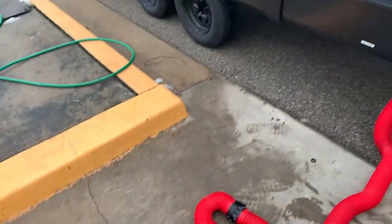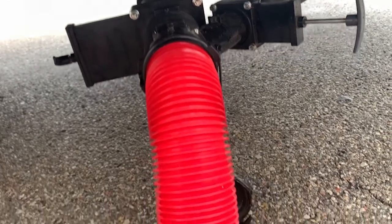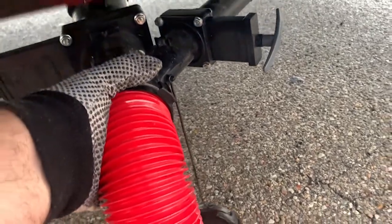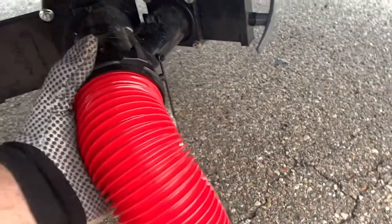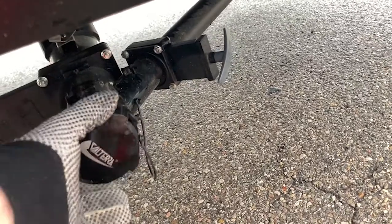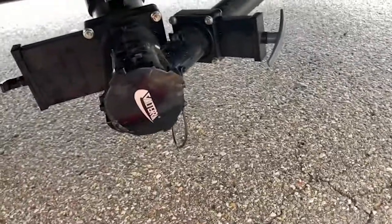This right here — you can see how it's tapered — you put that on the ground and spread it out to keep the hose pointing downhill. Now we've dumped the gray tank and cleared the water out of the hose. Make sure all the water is out, then shut the gray tank lever. A little drip and some aroma comes out — this is a dirty job. So now we're going to move to the front.